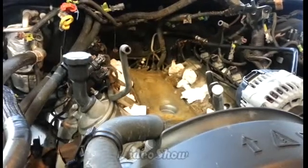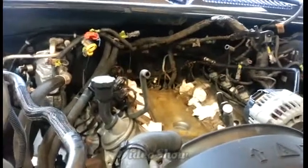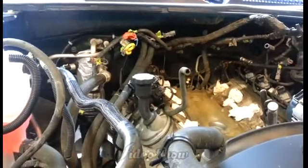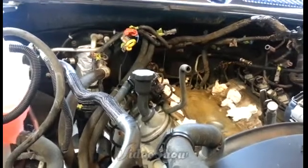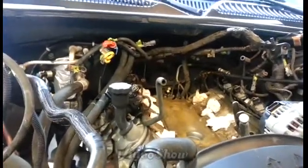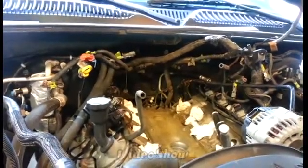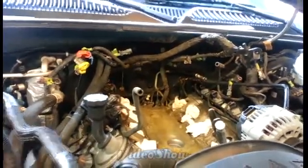But that's something. I mean, that's almost a $60 markup on the sensors alone. That's for a dealer item. I got them off rockauto.com, and it's pretty easy to get everything done. It's just time consuming. Marking where each injector harness goes, which injector, and then the main coil pack harness, disconnecting that, and fuel lines, and two vacuum lines, and then all the other sensors on that right there, guys.